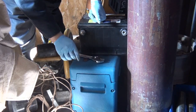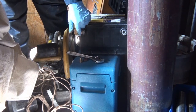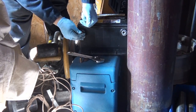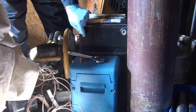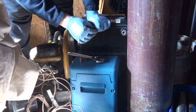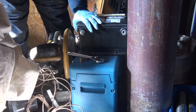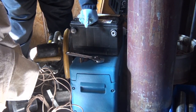That's pretty much how it's done. It took a little bit of force to get it in there, but it's only about four to six thousandths over the final diameter of the inside of this side post battery. Being that close to six thousandths, I was able to get a really nice tight fit. If I wanted to put this battery back in service I could — it's on there really nice and tight, with no acid leaking, so it's all safe. Now I can just insert a washer and tighten down my accessories like the solar panel.